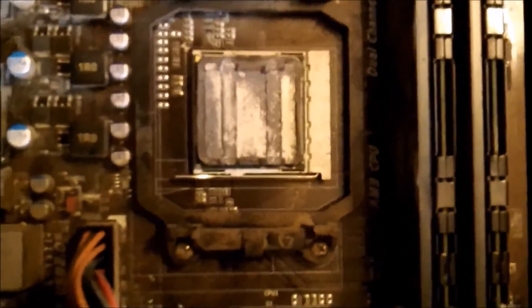The instructions say you have to put a support plate underneath the motherboard. I don't quite understand why manufacturers couldn't just incorporate the stock AMD or Intel support plate. In this case, there's actually a mat here and on the other side is a steel backing. This mat is to keep it quiet, so I have to remove it before I put the radiator in.